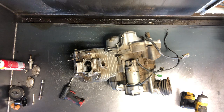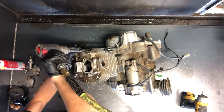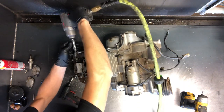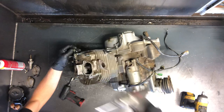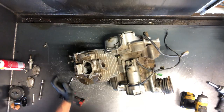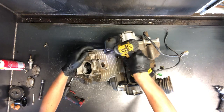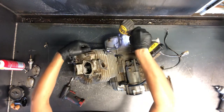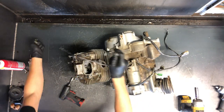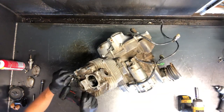I've got a couple of these 10-millimeters that are tight, and there's no need for them to be this tight. There's an oil line here that will pull off — that's got a banjo bolt, so make sure you put the right bolt back in this one. That just means it's got a hole going through it to allow oil to come up through there. Here's the rest of your oil line — pull that off. There's all three; the center one is not a banjo bolt, your other two are. Same style of bolt that would be on your brake lines, with fluid running through there.